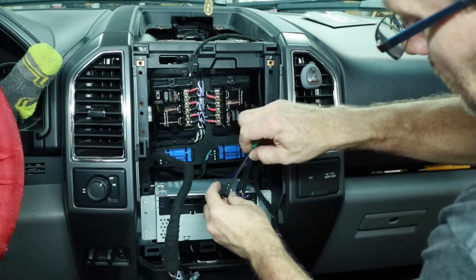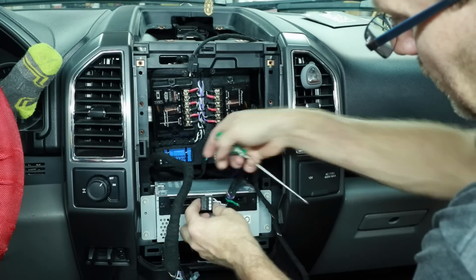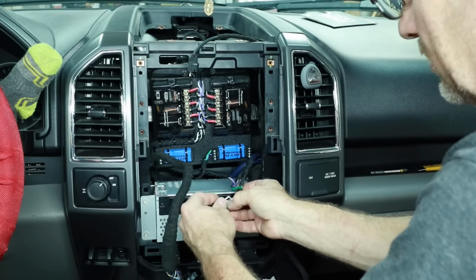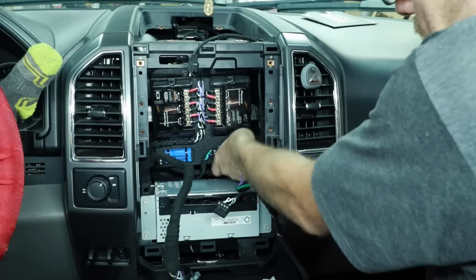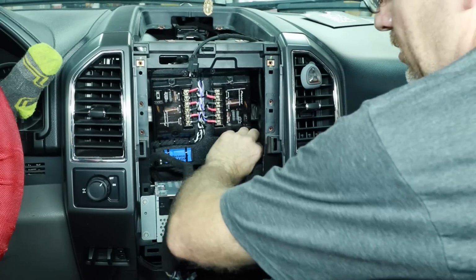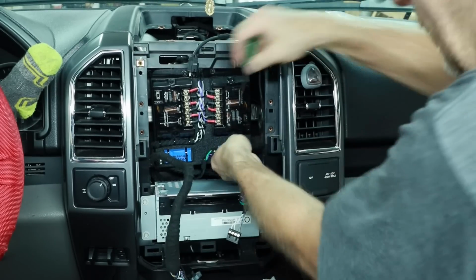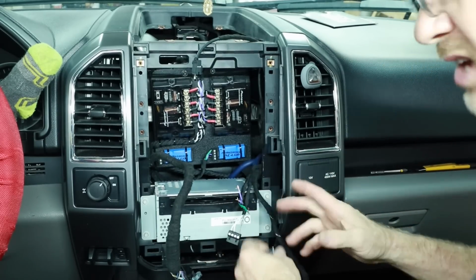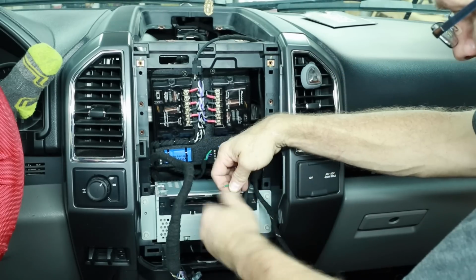The problem sometimes is finding out if you do have something out of polarity is where it's out of polarity, especially when you're doing a high level system. Screwing up the input is way worse than screwing up the output. There's fewer connections here on the input side going into the amplifier than on the output side. So you just have to be diligent when you're connecting these things. But accidents do happen, and polarity is one of the things that is easy to screw up.